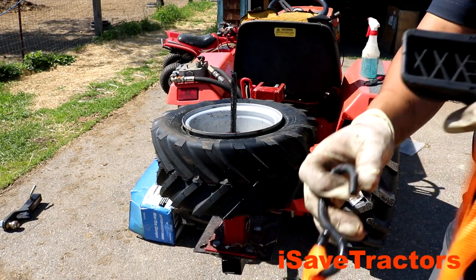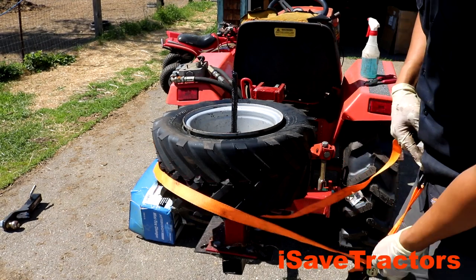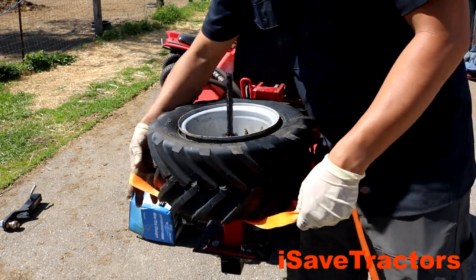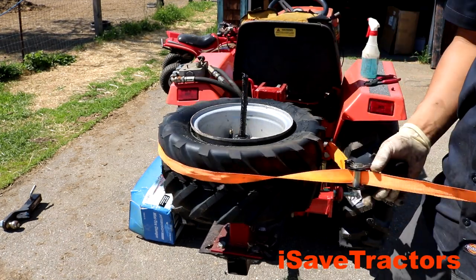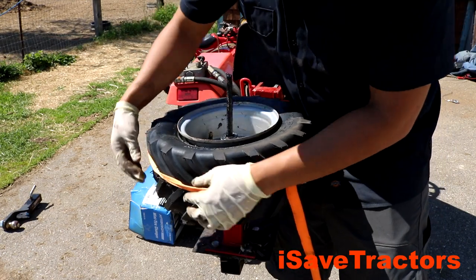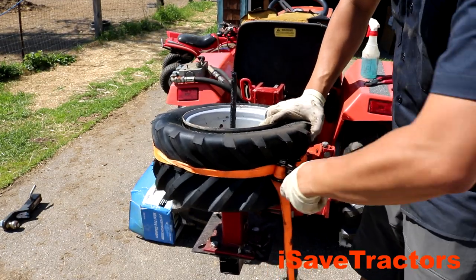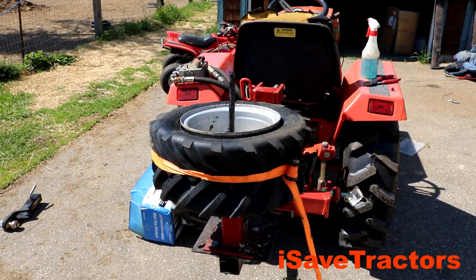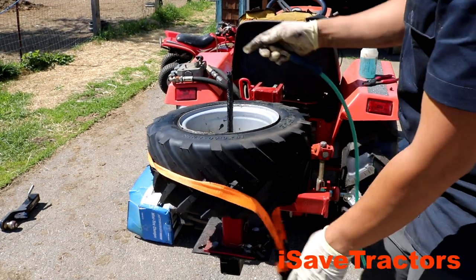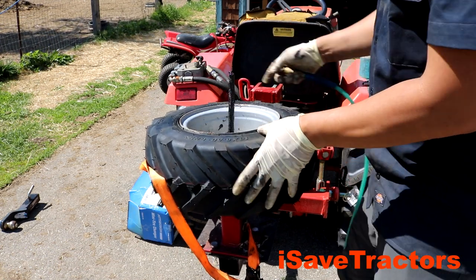You've probably seen on the internet or heard from your grandparents that one way to pop a tire bead back onto the rim is to use some carb cleaner or other flammable solvent and a lighter. I can speak from experience that it works and it is fun and exciting, but it is also dangerous. So the method I'm showing you right here uses a ratchet strap. I tighten that ratchet strap down the center line of the tire, which forces the bead of the tire outward. Once I start putting air in, it forces air out towards the edges of the tire, which helps seat that bead. As you put air in the tires, you'll feel those beads pop onto the rim. When that happens, you just release the ratchet strap, continue filling it with air, and that's it. Safe, no fire, no explosions — you can keep all your arm hair.